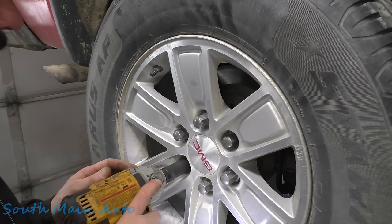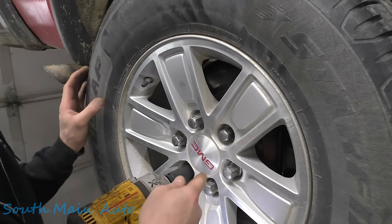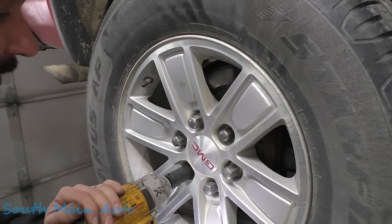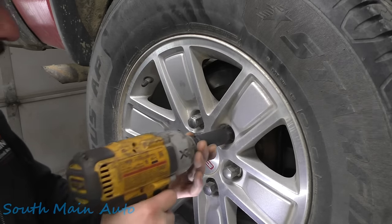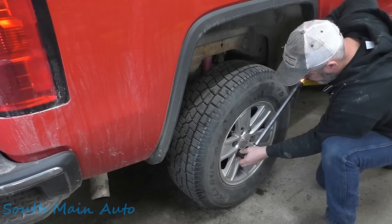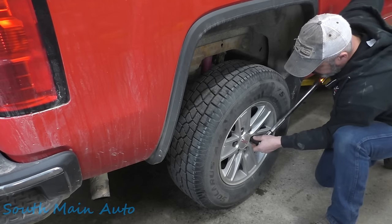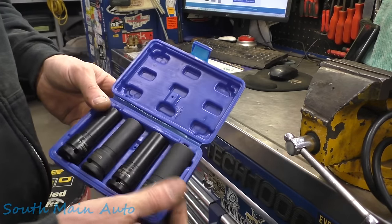I've got those also. And what you use them for here in the rust belt is we're oftentimes beating a socket onto a fastener. So you're going back and forth from metric to American, and you know, if there's anything in between. Some sizes there's not anything in between, like a 14 and a 15. But now that we have half sizes, now we can beat on sockets all day long. Yeah, so that's cool.